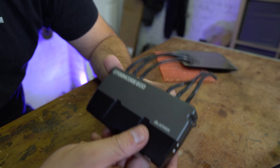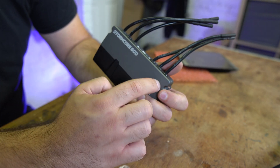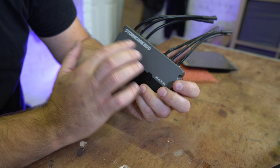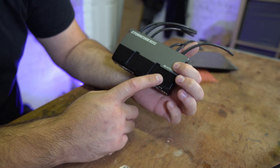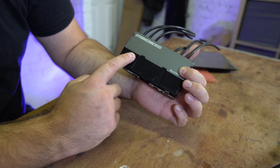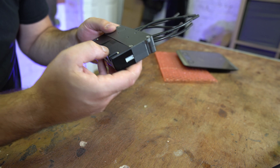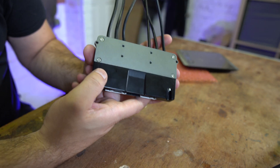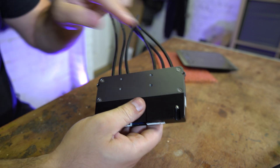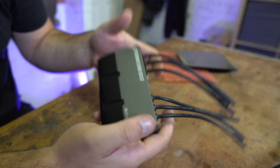The front section is plastic and the back is metal. The reason for this is to serve as a heatsink at the top — that's where the main power switching stages and MOSFETs are, along with some of the chips that run hot. At the bottom will be things like the Bluetooth module and other stuff that's not as critical thermally, though the Bluetooth antenna may need to be near the plastic for RF transparency. Looking at the screws, there are four on the underside and two on the side — I guess those two will free the plastic and the four will split the metal casing in half. There's only one way to find out.